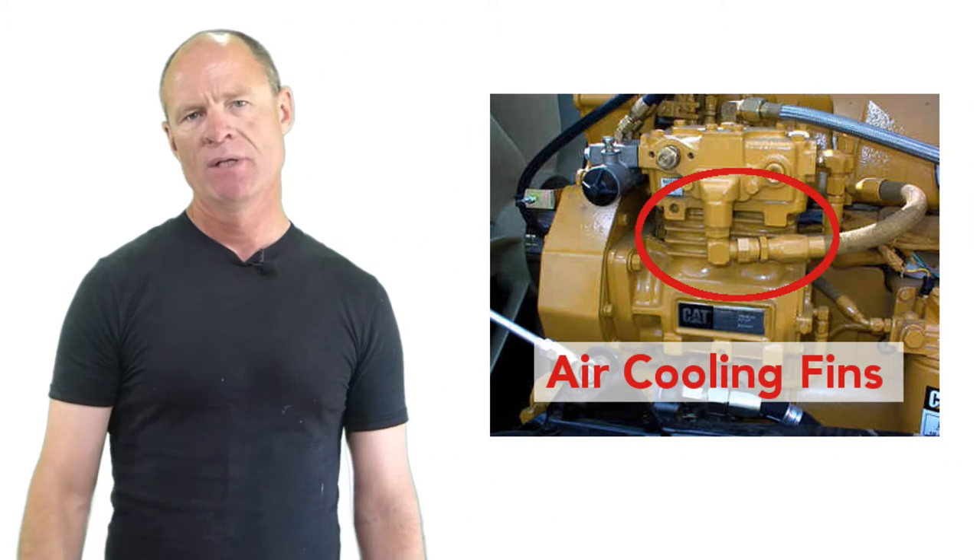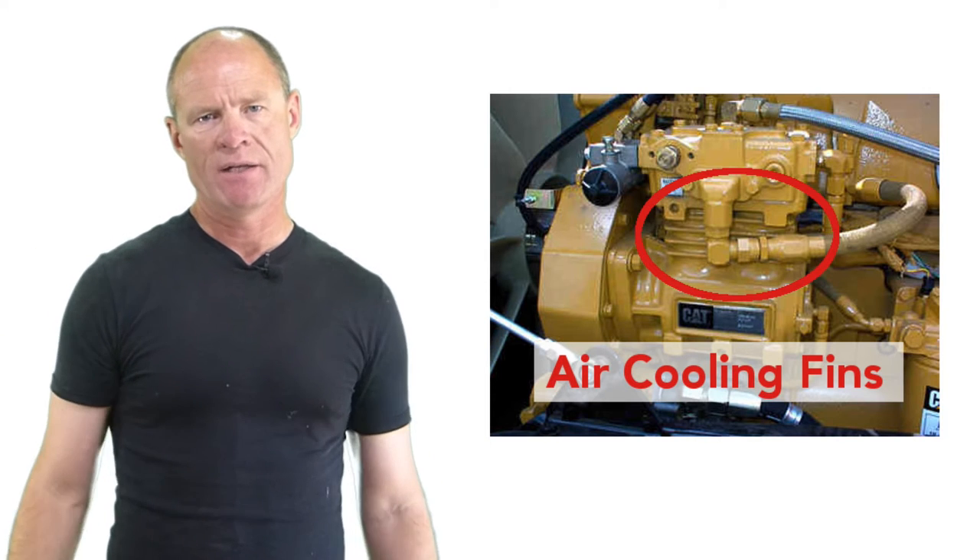Compressors on air brake systems are truly parasitic. They take power from the motor to be operated. They use the engine's lubricating system to be lubricated and cooled. They also use the engine's intake system to filter air into the system and compress it into the air brake system, air tanks and whatnot. In some rare cases they use the engine's cooling system as well. In most instances however they're just air cooled — there are fins on the side of the compressor.